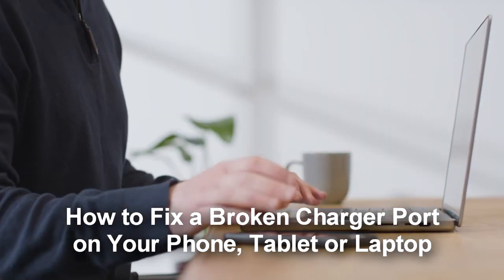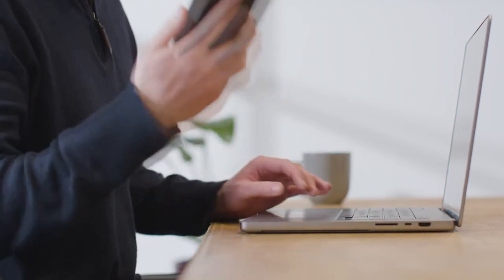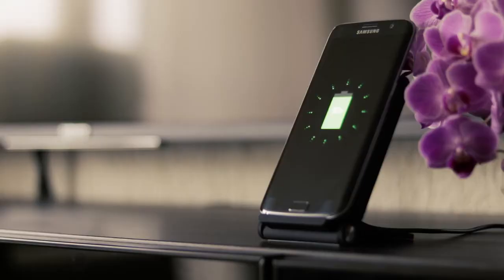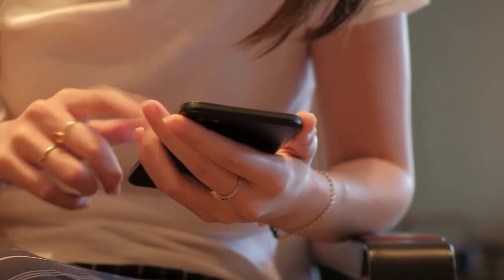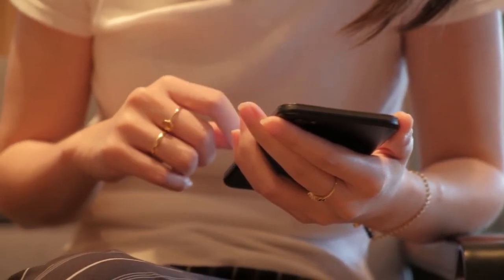After accessing it, you can try checking to see if there is any section that seems broken and try fixing it. For example, as shown below, you can try to tighten the metal plates around the charging port. Also, if you see some abnormalities, like the middle part being bent or damaged, you can try correcting it. Once you have tried the above, you can plug the power back in and see if there are signs to show that it's charging. If there are not, you can then proceed with the replacement.